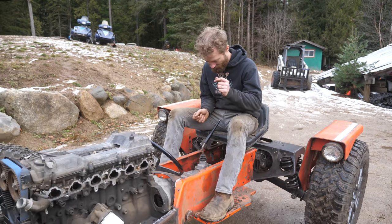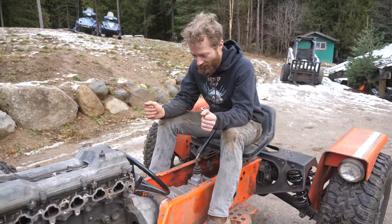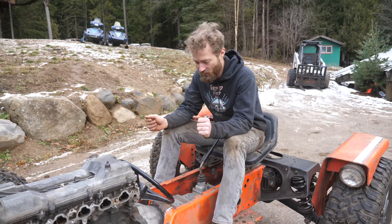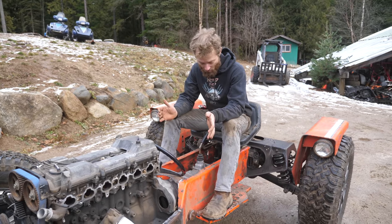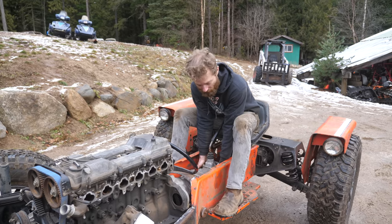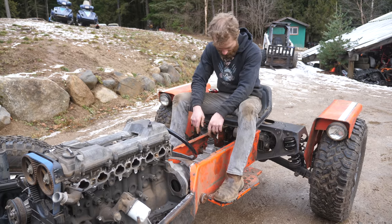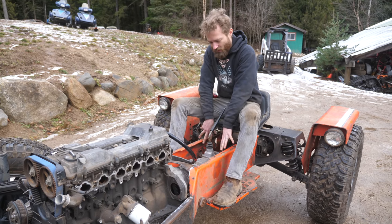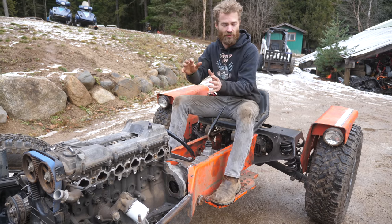Progress this week. Got the drive shaft completely done, all the engine mounts done, few other things. So we'll keep moving forward with reinforcing the frame and making more mounts. So again, I'm gonna make another mount for the back of the transmission that'll also be a chassis reinforcement. I'll do some reinforcing of this whole section of the chassis because it's sturdy this way, but it's not sturdy at all in any other direction.